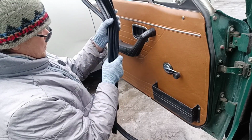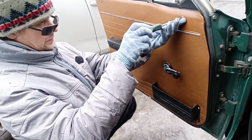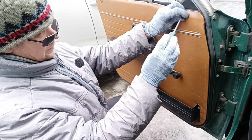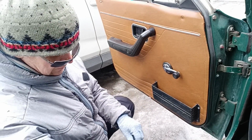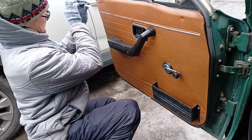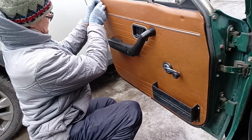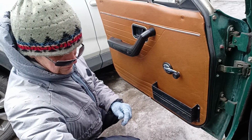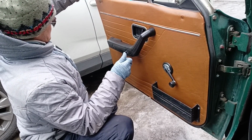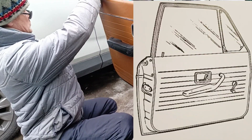And a very boring part of our work, yes, disconnect the door upholstery. And we start from the upper screws. Place small parts into a box, so as not to lose them. And then unscrewing the second securing screw. It's part of the original interior. This kind of washer is only used here. Cranking window good enough. Now I am unscrewing the lock knob.